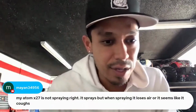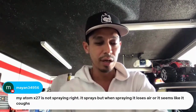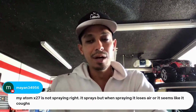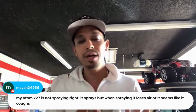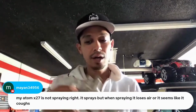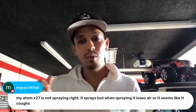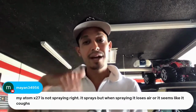Somebody says, Mayan says, my X is not spraying right. It sprays, but when it's spraying, it loses air, or it seems like it coughs. Well, the number one failure for spray guns is basically not cleaning them, or having it caked up inside. So the number one thing, no matter what spray gun you're using, Atom, Devilbiss, Astro, Iwata, Sata, you're going to want to make sure you take the thing apart when you're done. You don't have to take it apart completely, mainly your needle area and your cap. Clean it out, wash it out.